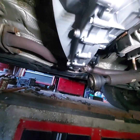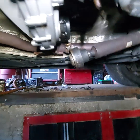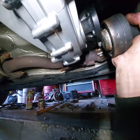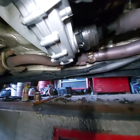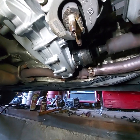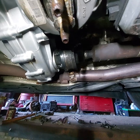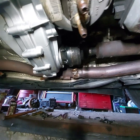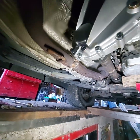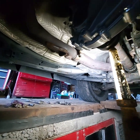And of course, this didn't have any oil in it. We'll get it filled up with the correct oil. And this is going to be a little snug getting in, but you just kind of wiggle it and it'll go in place. And start all your bolts before you tighten them down. And I believe the accurate torque spec on those, on your drive shaft yokes, is good and tight. And then we'll go ahead and I think I'll put them bolts in before I put the cross member in. So let me do that.